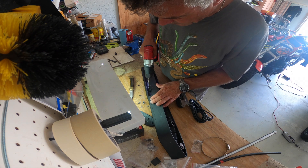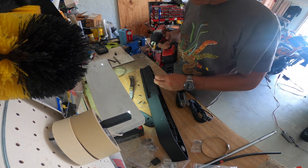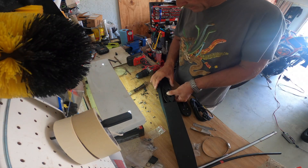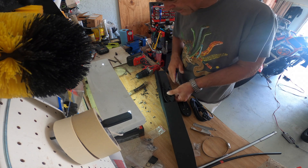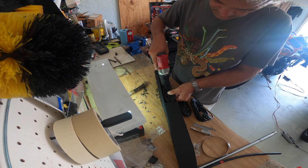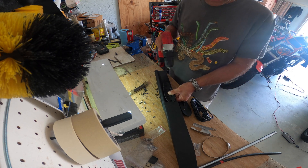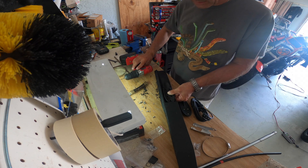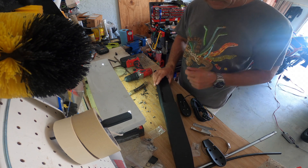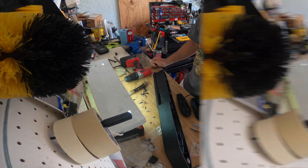We have to create a little bit of room to make sure the new transducer has the clearance it needs to fit tight into the system. I'm going to use a small drill and fine-tune it afterwards. As you can see we're getting a bit closer, making sure it doesn't go up against the hole on this side. I also need to make sure all the holes are going to fit when mounting the stainless steel mount on the other side. I'm marking them off now, and I need to put a little hole here as well so everything is still reinforced and the stabilizer still carries its strength.